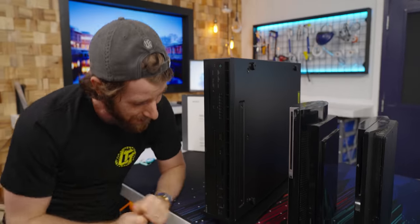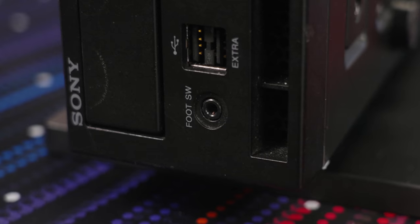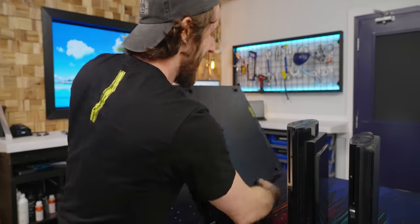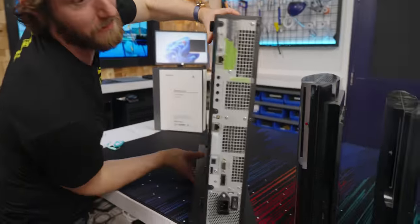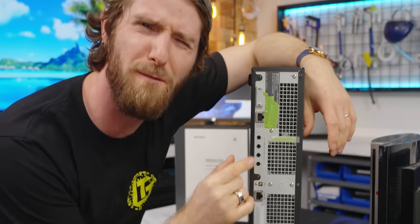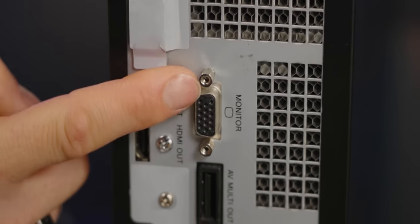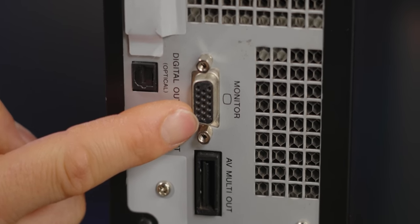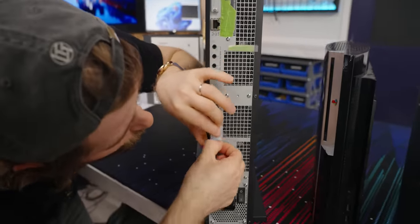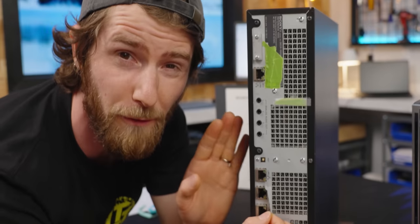But unlike that one, it's got two more USB ports, an entire additional hard drive, and whatever the foot switch is — actually that's really cool, we'll explain that later. Flipping it around to the back: not one but two network ports, one for developer use and one for regular use, four analog audio outputs apparently for sound mixing, a monitor port for your VGA CRT monitor. And if we look carefully under this tape, we can find two more Ethernet ports, apparently for low-level debugging only for Sony's use.